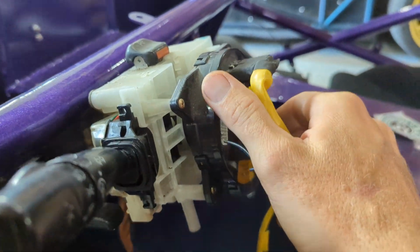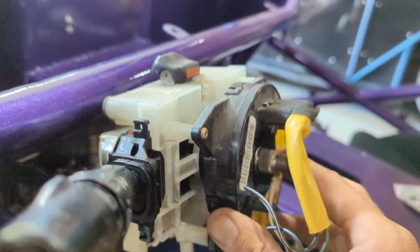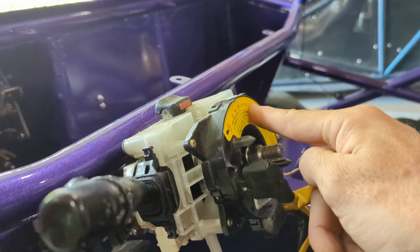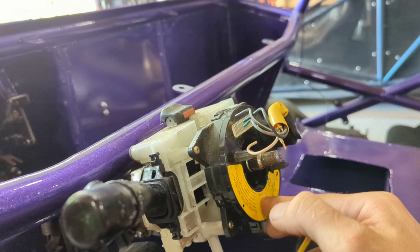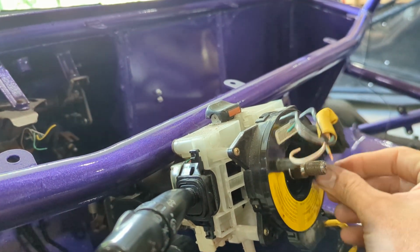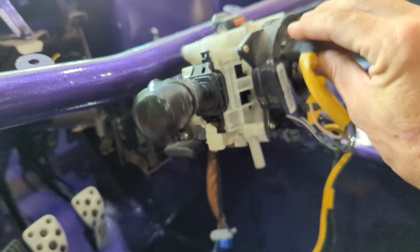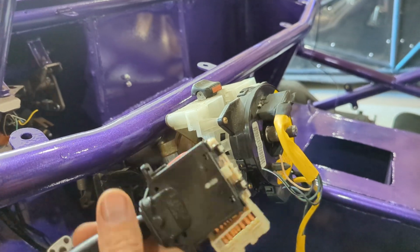Okay? No turn signal, thing at the top. Turn your turn signal on. You'll hear it click into that window. And then as you turn the wheel, it just kind of ratchets. It doesn't do anything. But then as soon as you start turning it back and it catches in that window, it turns your turn signals off. Look at that. That little thing on there has to go into that window so when you turn it back, it turns your turn signals off.